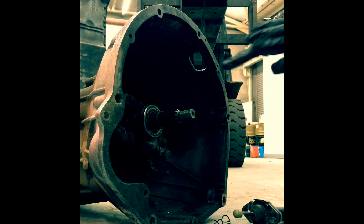The way I generally tend to do it: if you look at this side, that side has the cylinder in. This side has a pivot ball in — let's use the torch, there look. Pivot balls sometimes have a nut on the back like this one does. Sometimes they're threaded into the box, and sometimes they're plastic and not adjustable. So you want to wind that out. Bear in mind we want to move it 8mm, but because it's on a pivot, moving it out 8mm isn't going to give you 8mm — it's in the centre of the pivot, so it's probably going to give you 4mm. In reality, if you wanted to take the whole amount of travel up with that, you'd have to move it 16mm. I wouldn't advise that. I would try and do it evenly — perhaps extend this, or if this has enough travel, just maybe go 15mm with that.